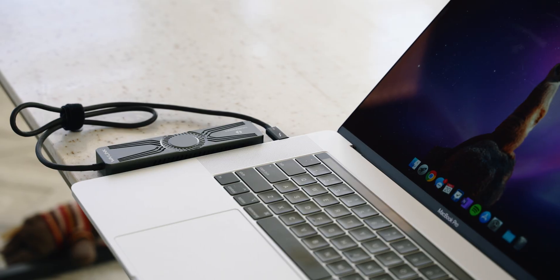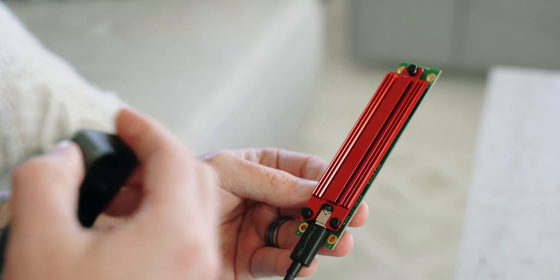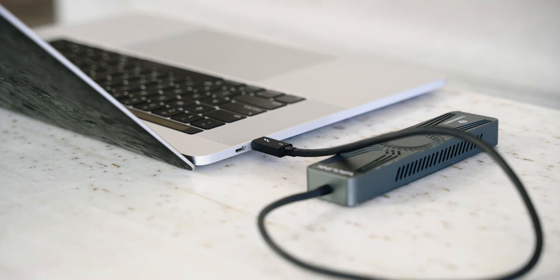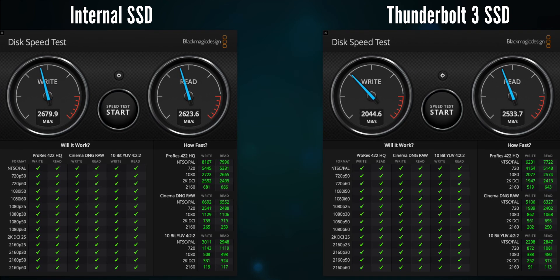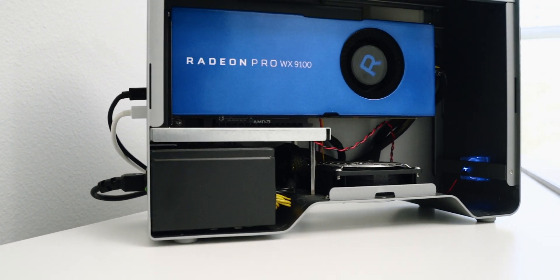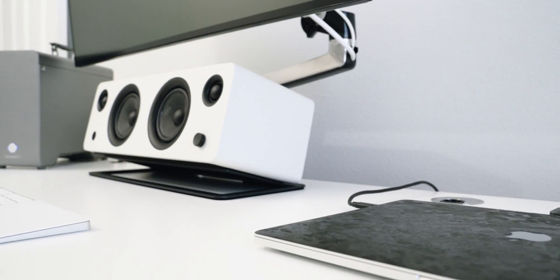The last thing I want to talk about for improving your current Mac's performance is utilizing your Thunderbolt 3 ports. If you have Thunderbolt 2, you can expand your storage and go the eGPU route, but I don't recommend it. If you have Thunderbolt 3, I definitely recommend both. This is a small Thunderbolt 3 NVMe enclosure — you can pick up a Samsung 970 or other NVMe drive up to two terabytes, install it in this enclosure, and gain insanely fast speeds. It's bus powered, so no wall plug needed, and it's going to give you speeds that exceed or match the SSD inside your MacBook Pro. For GPU expansion, thanks to macOS Catalina and its Metal acceleration enhancements, using an AMD GPU with your Mac will give you significant performance gains, especially for video editing.